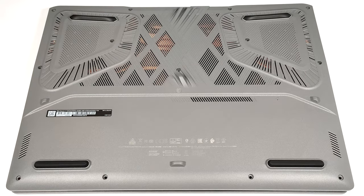With that out of the way, a tiny gap is revealed on the back between the bottom plate and the base. So first, we have to pop the rear. All internal clips feel super stiff and you have to push much harder than usual with the thin prying tool. The bottom panel also seems thin and spongy, especially around the ventilation grill, so don't bend it too much because you can break it.